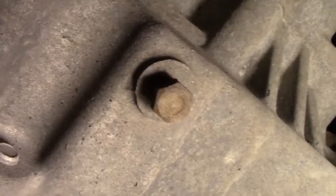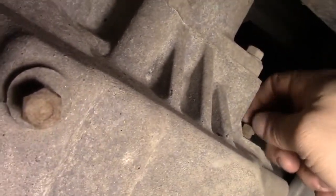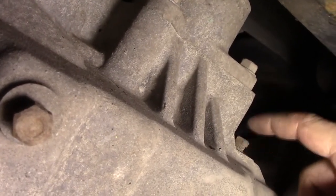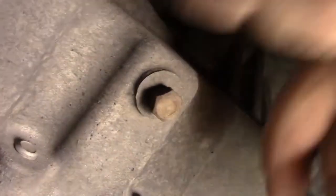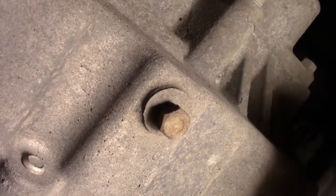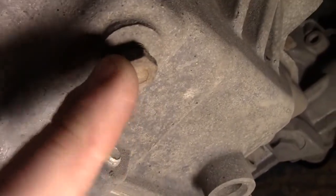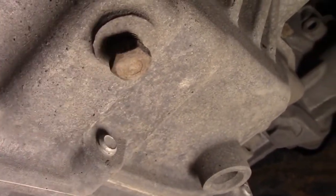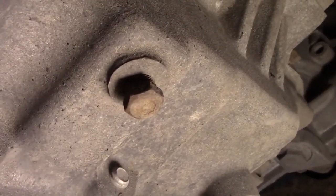You can pull this out — I've heard they're tapered and have kind of thin threads, so you have to be careful. That is the top-off fill port. When a little bit dribbles out of there, you know it's full. This is the drain plug. It's pretty straightforward. When I come back I'll unscrew this — I believe it's 11 millimeter. The one on top I think is 19. It's probably a good idea to open the top one first so it doesn't create a vacuum, which might help it drain more fluid.